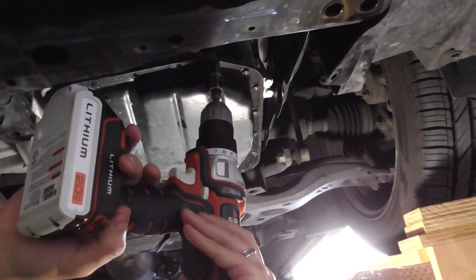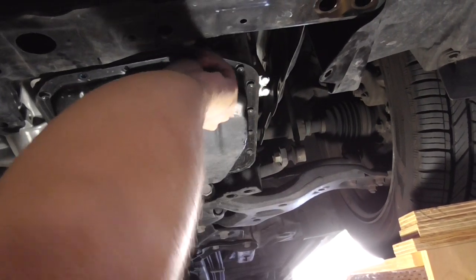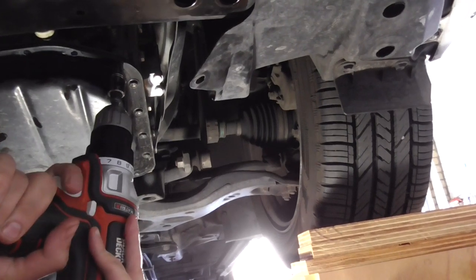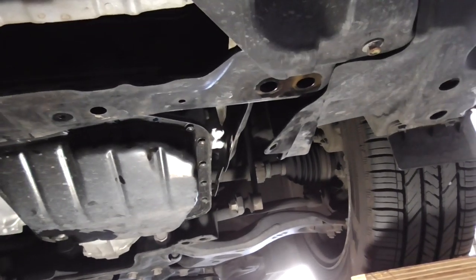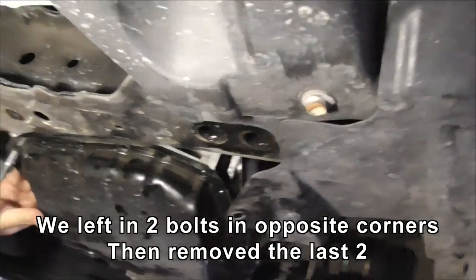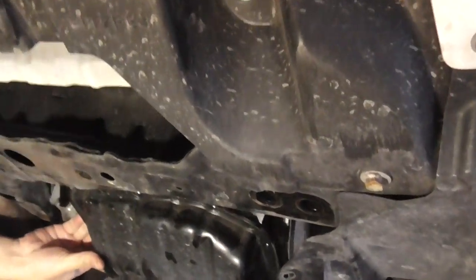To get the screws out — they've got Loctite on them — so it's a pain to take them out by hand. Torque is low, these are 10 foot-pounds. We're going to crack them all first and then use the power driver to get them out. We're in the process of taking the last bolt out on the last corner. Let's see if we can get the bolt out first — that might stay up because the gasket is kind of stuck. Got it. That way it can't fall into my drain pan.